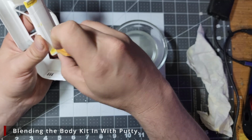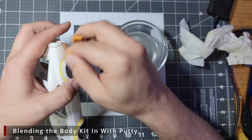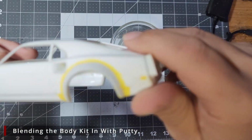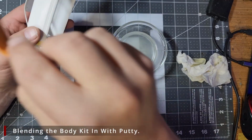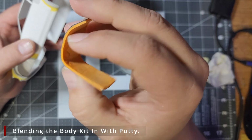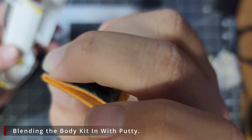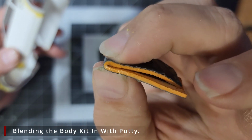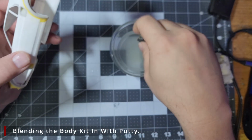There's going to be a lot of jumping ahead through this section. That's going to get us to about here. We're going to refine this a bit more by switching to a thin pad. The thinner the sponge part of the sanding pad is, the tighter that curve gets. And the tighter that curve gets, the tighter we can get in on this groove.